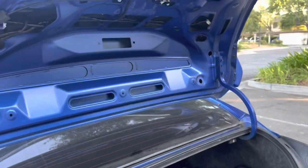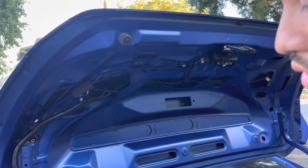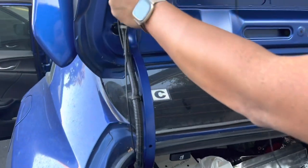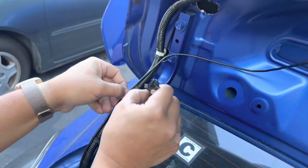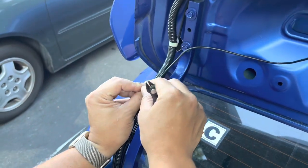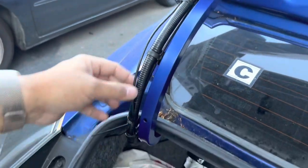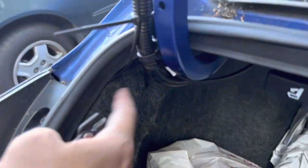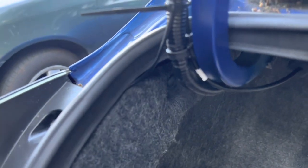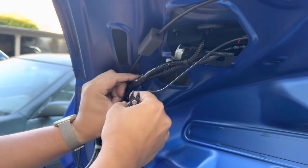To reach the camera — here's the rest of the wiring. We're going to follow this line over here, zip tie, zip tie, get through, and end up right here. I'm zip-tying the wiring so that it follows the stock wiring that goes to the taillights, trying to make it a clean install and so it doesn't bind. It's coming from behind the liner here. I tried my best to hide the wiring — you can do a better job if you take the time, but I'm in a rush before it gets dark.